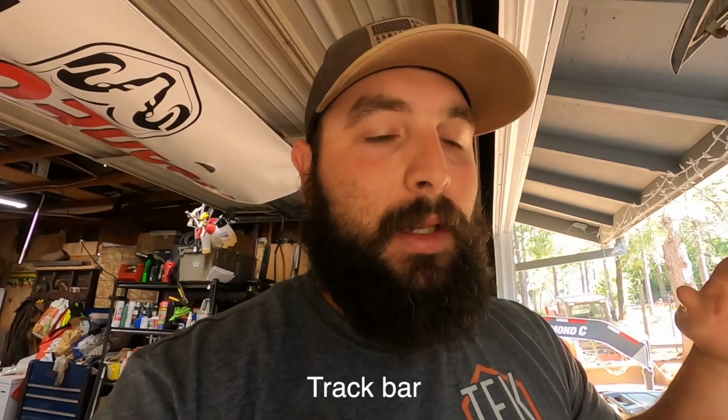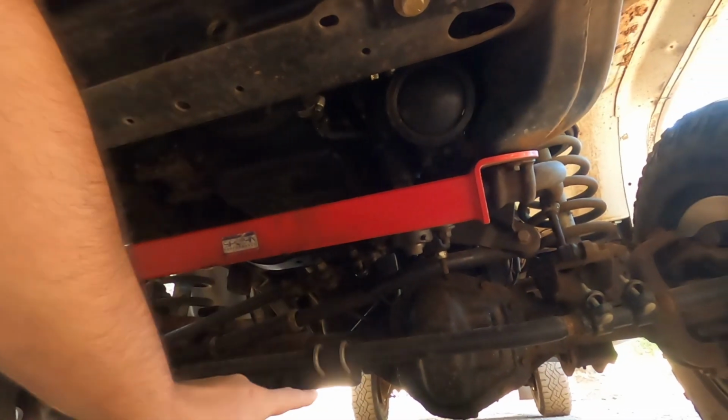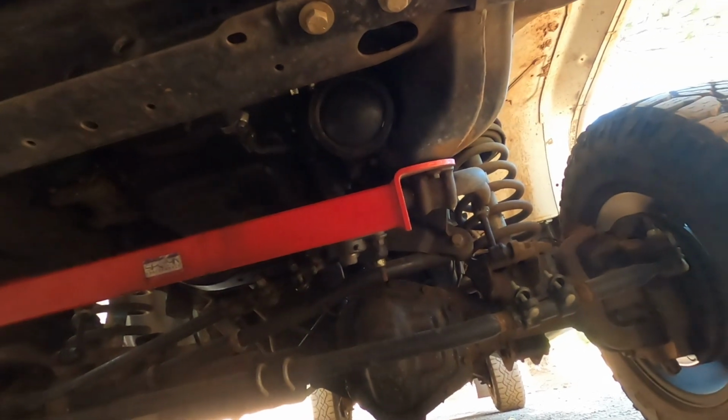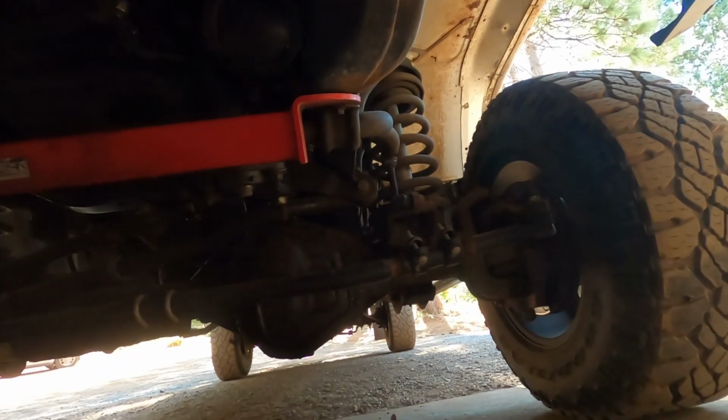I did a ton of work on the front steering of the truck. It still has a little bit of a wobble to it, but upgraded to a 4th gen steering system, upgraded to a 3rd gen tie rod system. I'll show you guys all that. So that's all your 4th gen stuff, 3rd gen tie rod, and this brace. I replaced the power steering box, stuff like that. I got rid of the vacuum disconnect for the front axle. It's now a cable lock. So small things like that.